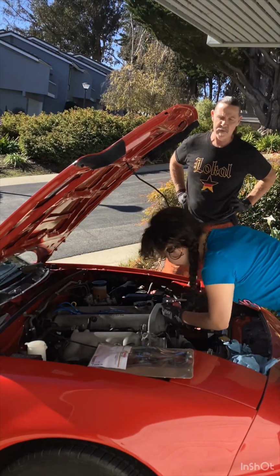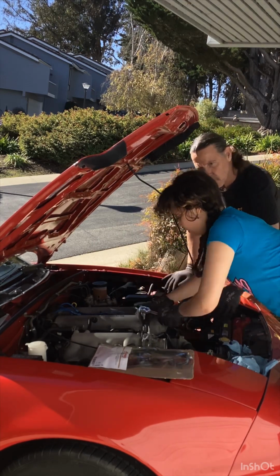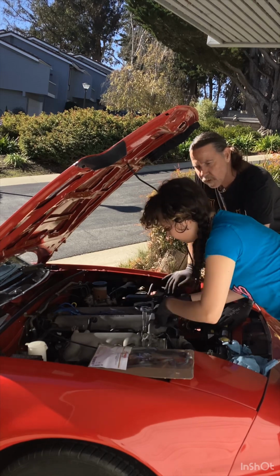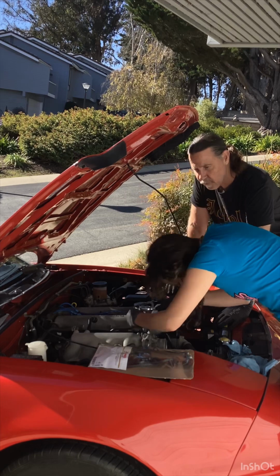Sequence when we get ready. So you notice that that's only 6 to 7 foot-pounds. Do you know the feel of it when you crack it loose? Yeah. Because our torque wrench doesn't go down that low. So I'm going to be doing it by touch. It's aluminum, so.